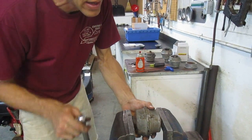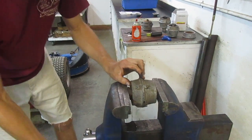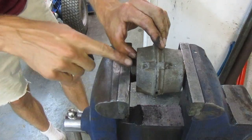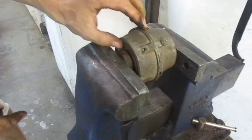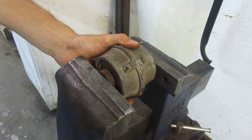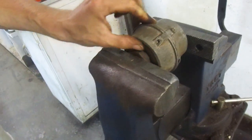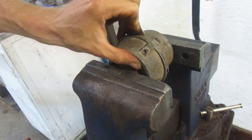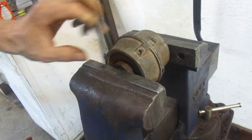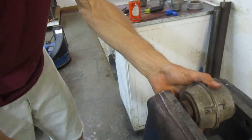Once the clutch is back together, you can test it by compressing the inner spring in the vise and simulating the clutch action. If both bearings were good, you could roll the inside cone pretty easily with your thumb. I can't do that on this clutch because the bearings are bad — I cannot roll that inner cone. Now that I've compressed it, the inner and outer cone are touching and it only should roll on the bearings, but you can hear that it sounds nasty — all that gritty sound is from the bad bearings. These bearings obviously need to be replaced, but that's how you can easily test the clutch.